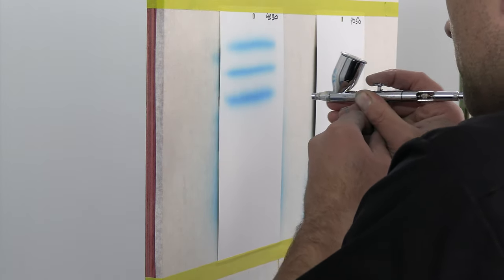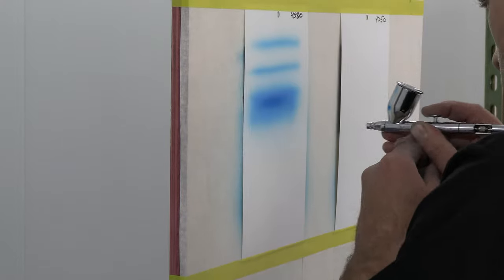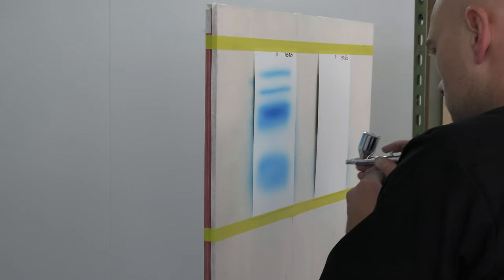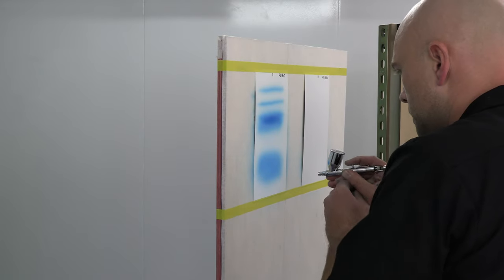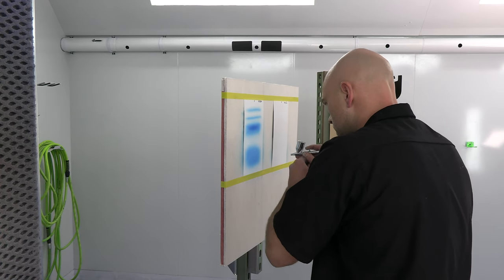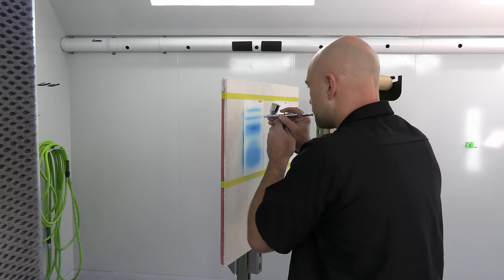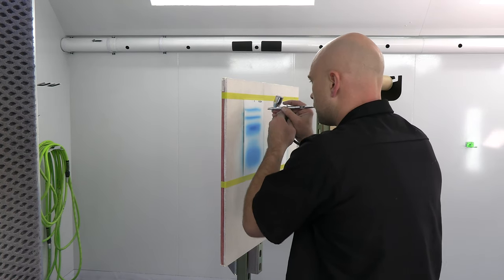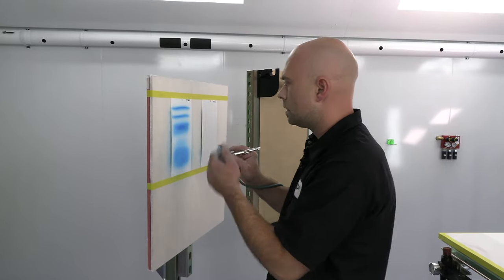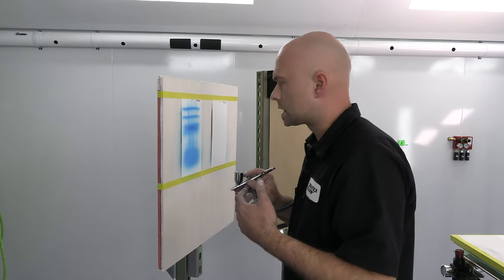The whole deal with the candy is being able to work in light coats and gradually build up your color. So for the airbrush, the 40-30 is great. You can see I can build color nice, get a nice fade — it's gradual, dries pretty fast, which is really what the 40-30 was initially designed for: the carrier for this Candy 2.0 system. You can see I was able to move pretty fast — pull lines relatively quick. It moves nice. It is candy, so it is a little bit thinner in viscosity, but that's really not a problem.